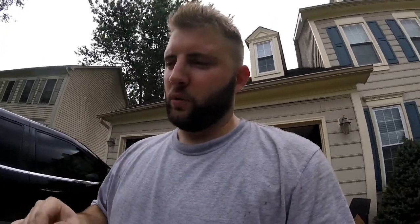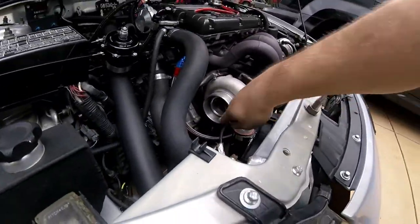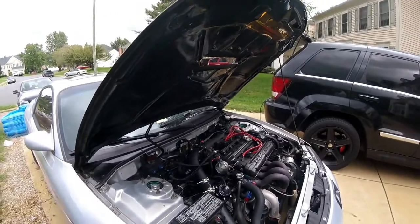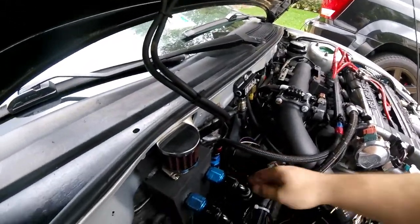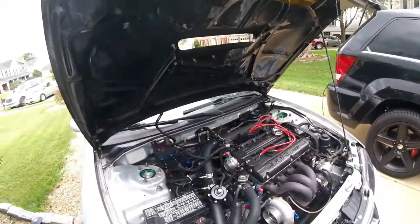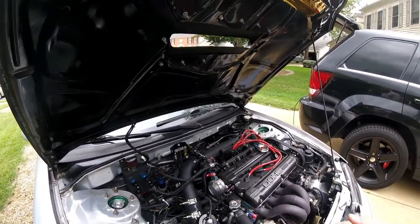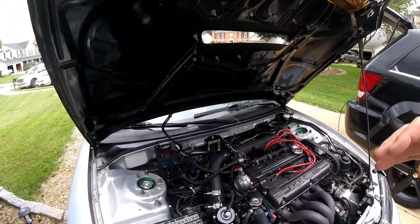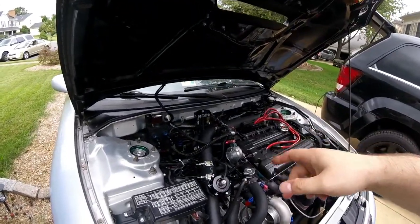Today was a good day - I accomplished everything I wanted to accomplish before it started raining. The new oil return line is on, hopefully no leaks, we'll see after a couple weeks. We also got the new knock sensor installed. I was getting a lot of phantom knock and I couldn't boost past three grand. I pulled out the old one - the connector was also a little burnt up. I put in the Evo 8 one. Just so you guys know, DSM and Evo 8 knock sensors fit.